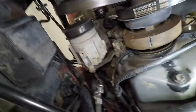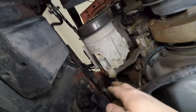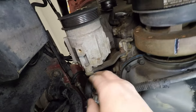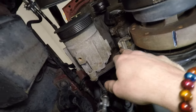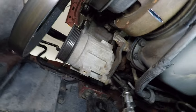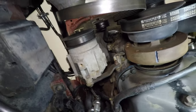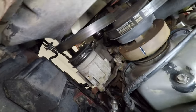Here's a better look at the smog pump from underneath. You've got to take out this nine-sixteenths bolt, then this half-inch nut, and on top there's a nine-sixteenths bolt as well. I'm just going to get these guys loose and then we'll drop this pump out and have a look at it on the bench.